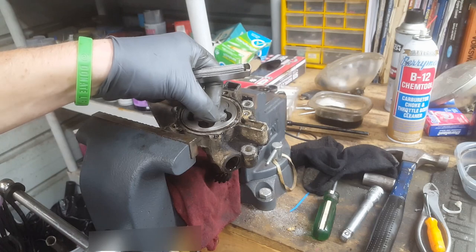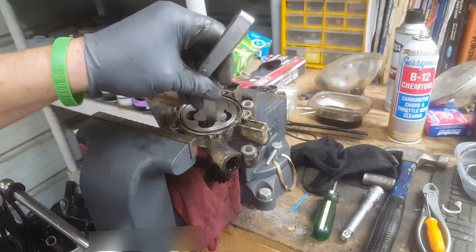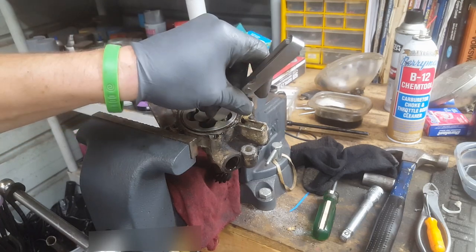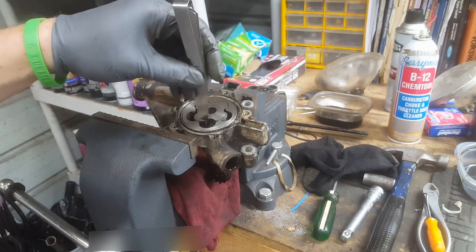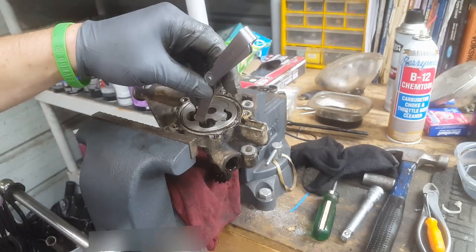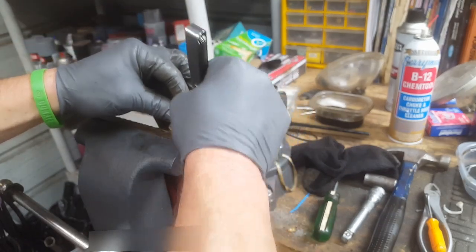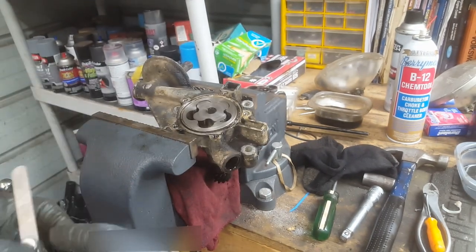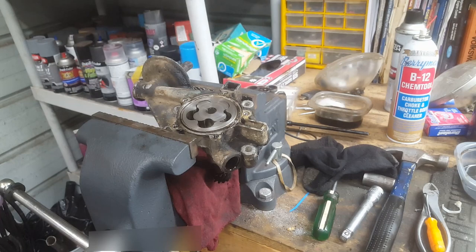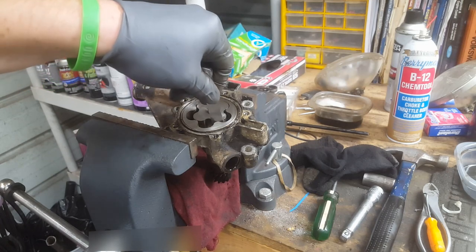this area right here, measured in two places, and I'm just barely able to get a 16-thousandths feeler gauge in there. Try it over here to replicate my results. It didn't go easily. I'd say I'm closer to 15-thousandths. In fact, I think a 15-thousandths would actually go in there easier, because we'll be legit about it. I'm always legit. 15-thousandths slips right in pretty well.